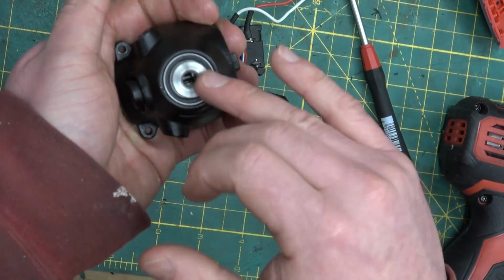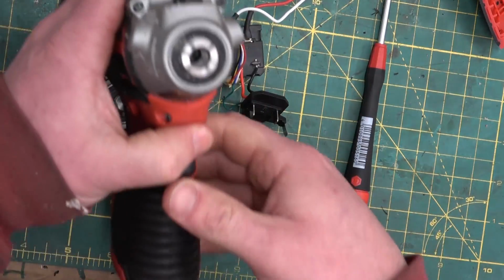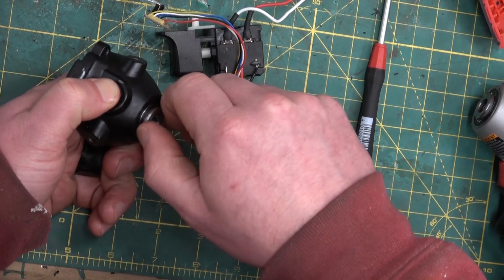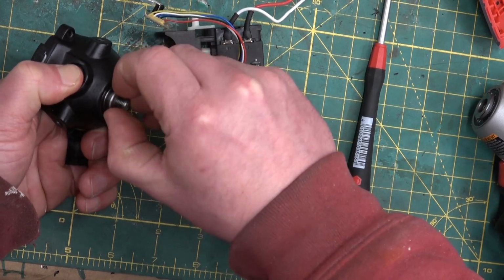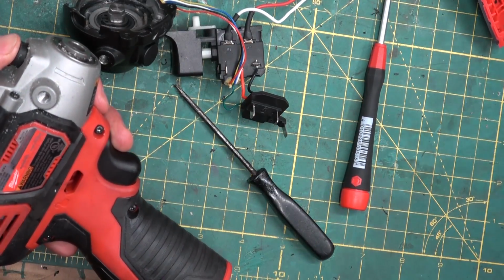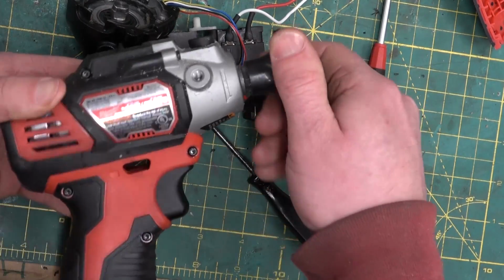The difference in the manufacturing on the spindle end is that for the locking mechanism, they've through drilled it. They've through drilled this straight across, and on the Milwaukee, they've gone in and just drilled it to depth on either side. So they've done two processes as opposed to straight through on this guy. There are two diametrically opposed slots, and you can see that pin weeble wobble in there pretty good. So there is quite a bit of slop in that pin, and in this guy, tough to turn, because we're driving the motor backwards. Yeah, roughly the same amount of slop in this guy.